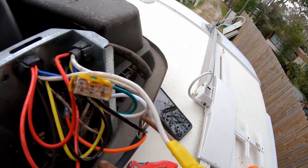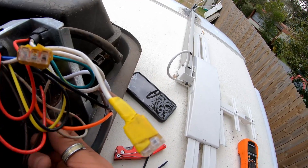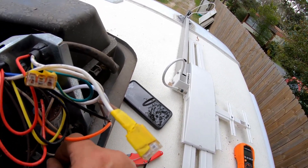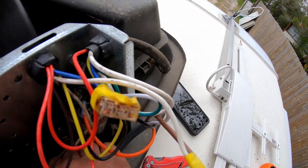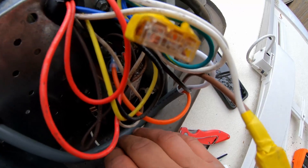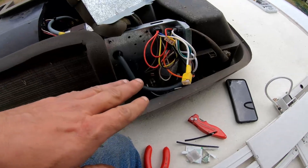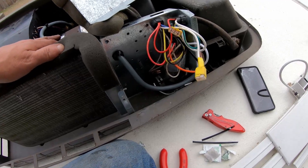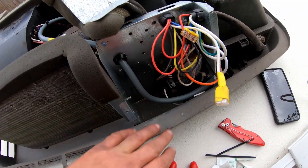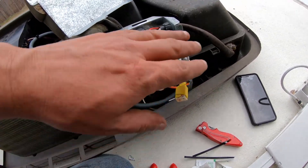It's disconnected and out of the way. Now we follow this other black wire up here. Some people will remove this capacitor — I'm not going to. I'm going to leave it in here, because that way if the owner goes to sell the coach and wants to keep this Micro Air unit, he can easily put the original capacitor back in. Now all we need to do is get it put back together.